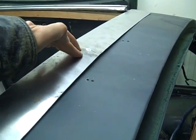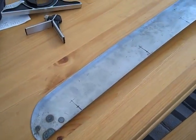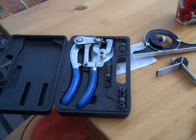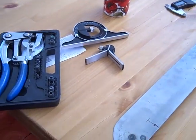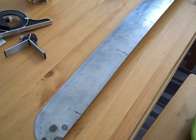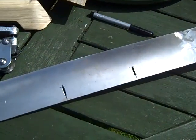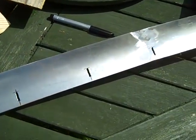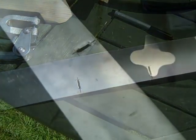When you screw it to the roof of the car you can't actually see the screws through the vinyl. We've marked up the hole positions and we're going to punch them with the Whitney punch, make sure they're clean, and then sink them down. We're going to cut slightly smaller holes than required so that when we countersink the material it will actually open up the holes. Those holes are now nibbled out and we're just going to file over the unevenness before countersinking them.